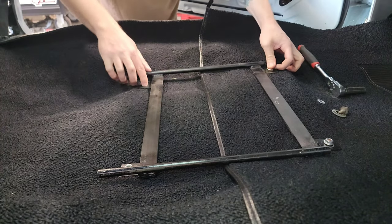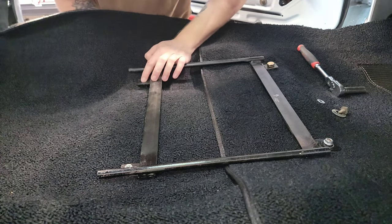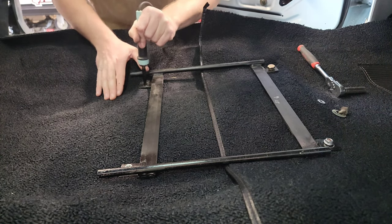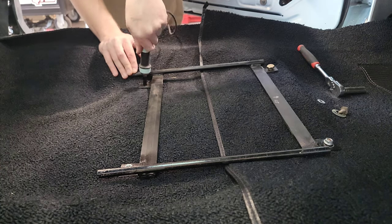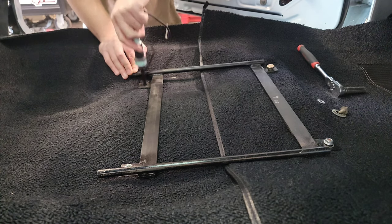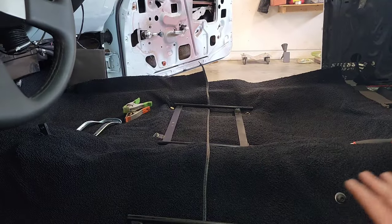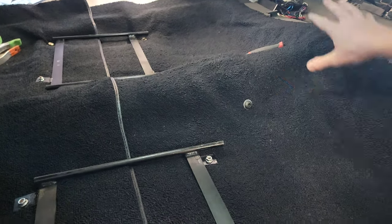Make sure the bracket's straight — should be right underneath there. I feel with my finger gauge and it is. So I'm going to melt that right on through and I should line it up. Let it go in there in the hole — and this one's actually got a built-in template. Now that the seat brackets are both locked down, you can go back to get your rear seat belt bolts and whatever else you have that need to get burned in.